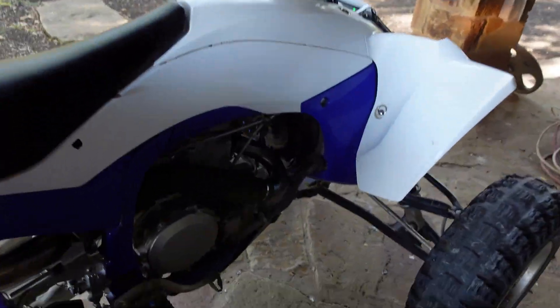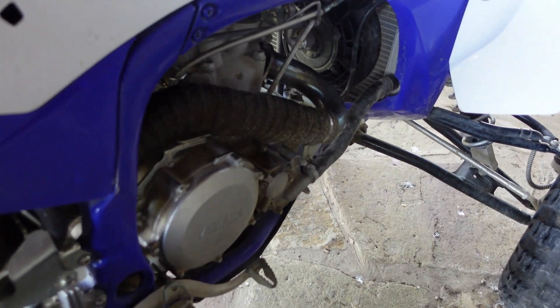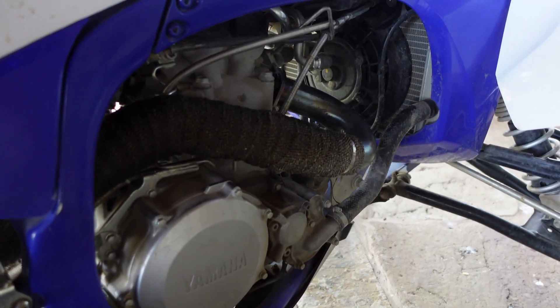Check it out, right now it's steaming a little bit. All that steaming is perfectly normal — it's the water I used to soak up the heat wrap so the fiberglass wouldn't get everywhere, plus the chemicals inside of the heat wrap. Whenever they're actually making it, they use a special glue that's supposed to burn off when you start it up for the very first time. So if y'all ever put on a heat wrap, expect it to smoke a little bit. It's not going to burn up, it's just releasing those chemicals.